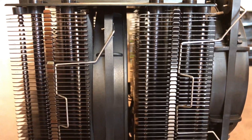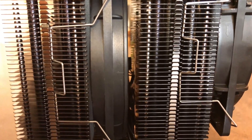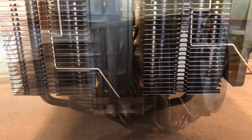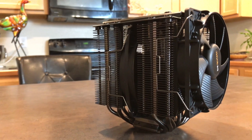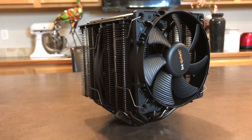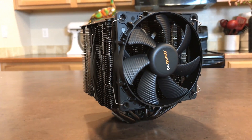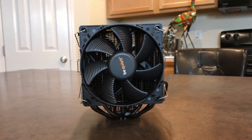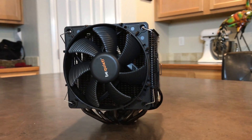There is an enhanced double-tower layout, which reduces weight and enables high cooling power. There are also two Silent Wings PWM fans — a 120mm in the front and a 135mm one in the middle. It also features a decoupled fan mount, which reduces vibration and keeps noise low at 26.1 dBA, even at 100% PWM fan function.